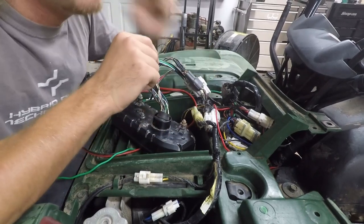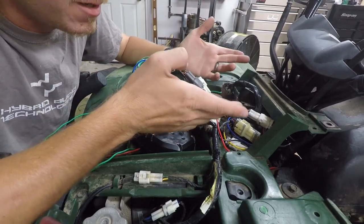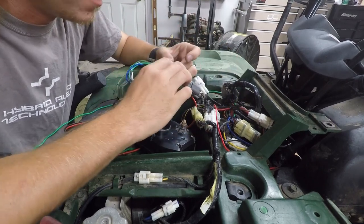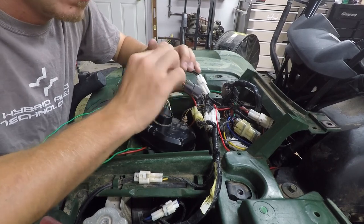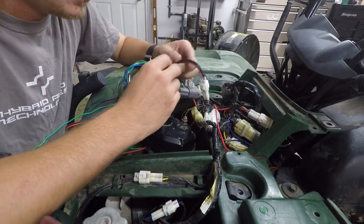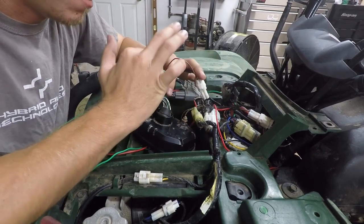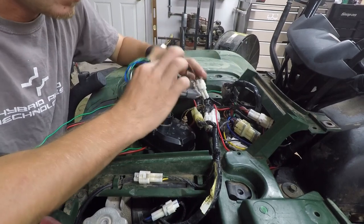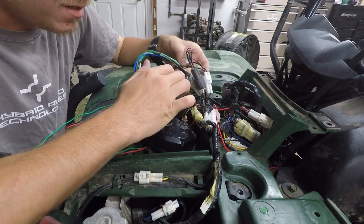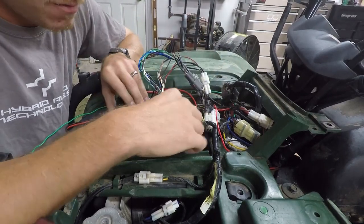One of the more common issues I've been seeing is that a fuse is corroded and one of the leads isn't getting power. There are two ways this unit gets power: a brown and blue traced wire for illumination, and a red and green wire in the harness for everything else. Both are present and good. Ground is also good. This harness got chewed up by mice years back and I had to repair it a long time ago.